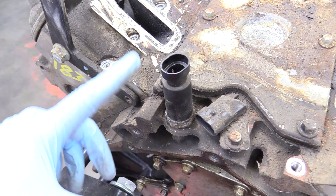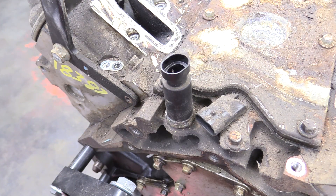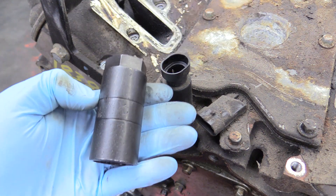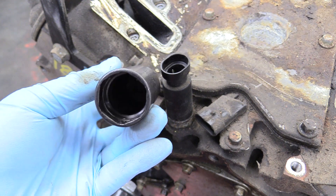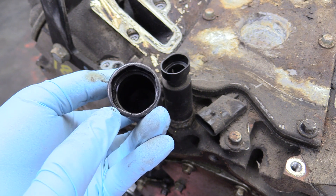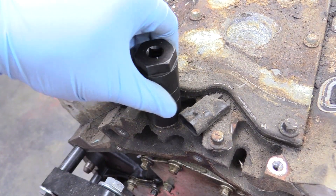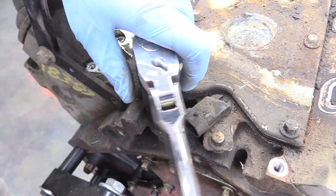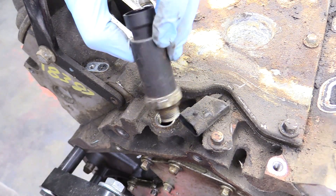The first thing we're going to focus on is the oil pressure switch. It might look like a regular nut arrangement at the base and you'd think you could get a big enough wrench on there, but that's not really the case. What you actually need is this special socket — I have a USA-made one with a link in the description. It looks like a regular hex socket but there are little lobes at the very tip of each point, and those are essential for getting the switch out. It comes out really easy when you have the right tools.